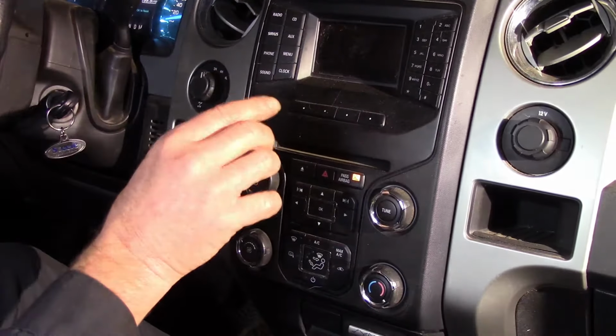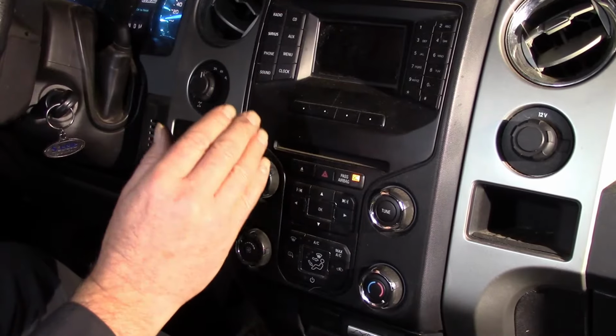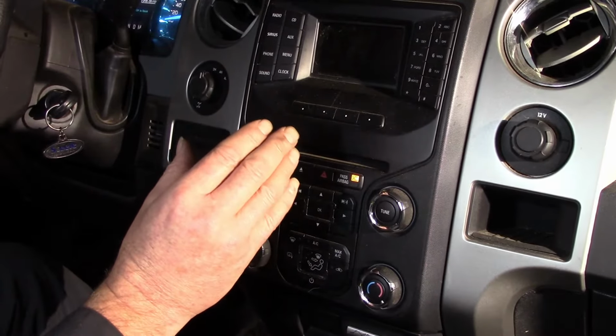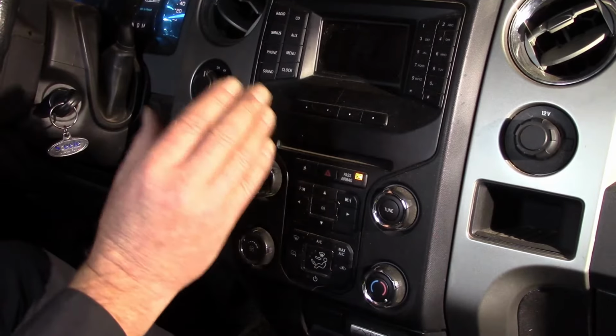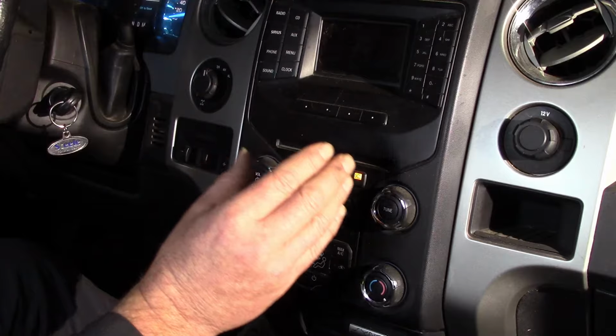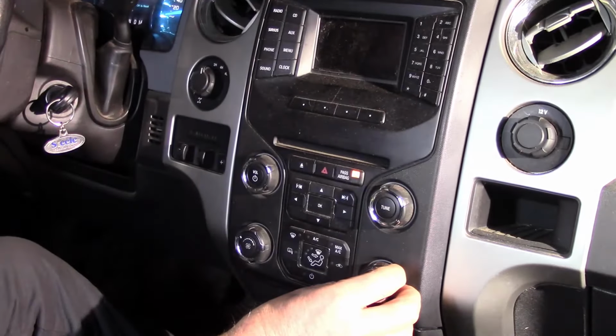I do not hear the motor, the actuator, trying to move the door. So either the motor has no power and the motor is gone, which is what I think is happening, or there's no door in there. The door is totally disintegrated, but I don't think that is the issue.